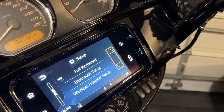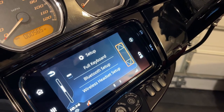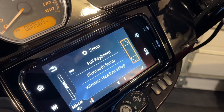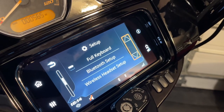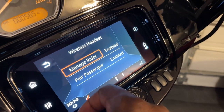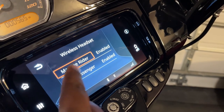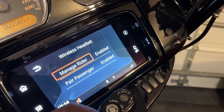On this one, I had to have it installed. The WIM module costs about $300, and it costs about another $200 for the harnesses and other parts, plus labor to have Harley-Davidson install it — total came out to about $500 for me. If you have a CVO, you should already have this because CVOs come with the WIM already installed. Also note: once you install the WIM, they do have to flash this head unit so it can recognize the installation, so they recommend taking it to a Harley dealership for that.